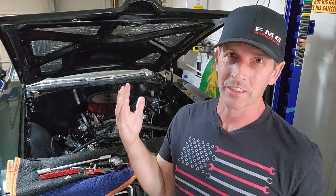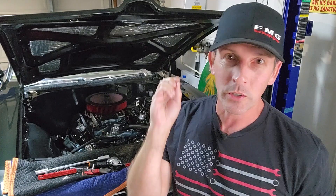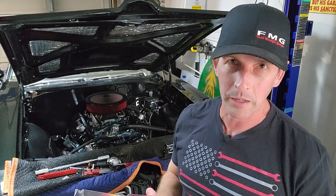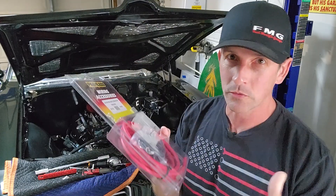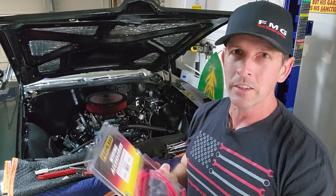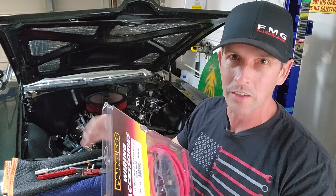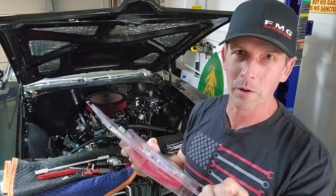We're not done yet. While I was Googling that hot alternator issue, remember that one wire that looked a little toasty? When you upgrade your alternator to a higher amp, you also need to pay attention to your charge wire size. Mine's not big enough — there is a chart online; I'll try and find it and post it. Painless Performance makes a cool little kit with six gauge charge wire, a bigger fuse, and instructions. It doesn't matter if you already have a Painless Performance wire harness or you're just adding it to your system — you still need a bigger wire. I'm going to go ahead and do that, but I'm not going to film it in detail. I'll quickly show you the before and after.